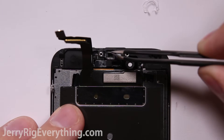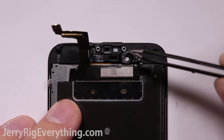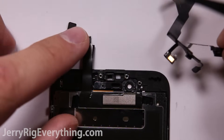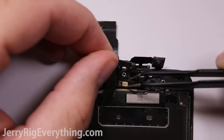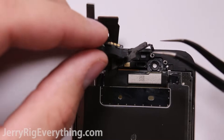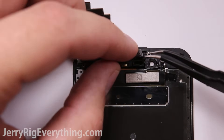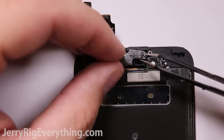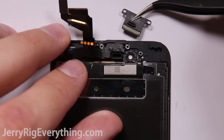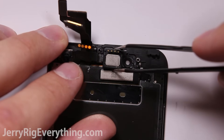Install the plastic bits onto your new screen — you don't need to glue them in. It's actually dangerous to use glue because it might get on the lens itself. It's pretty easy to get the ribbon cable assembly back into place: start with the little gold unit at the bottom, then line up the square pieces at the top and tuck them into the plastic bracket. Push them down flush and then tuck the little niblet on the earpiece down into its hole until you feel it seat into place.